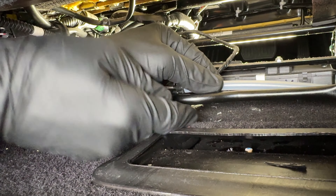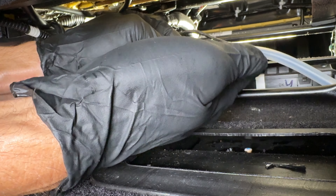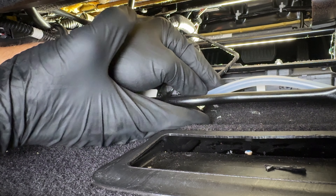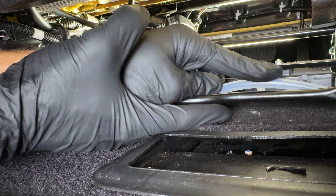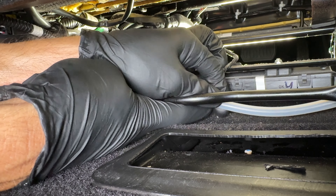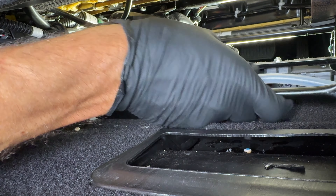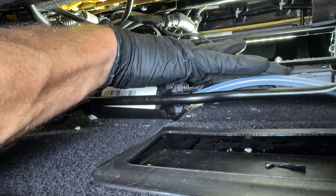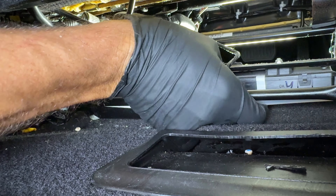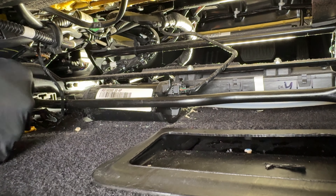Now focus on the other side — this end just slides right into the motor housing. I bend it up a little bit and slide it in, and you can see it keeps this little natural bend in it. I'm going to press the motor so that it actually seats it. You can't really rotate this side, so I hold it down and push on the motor — it slides forward just a little bit and then actually slides in, and the bend goes away. It's in there now.